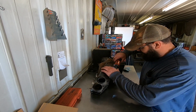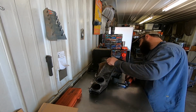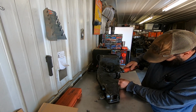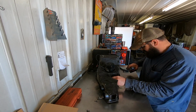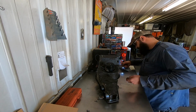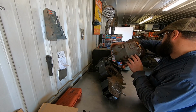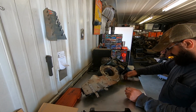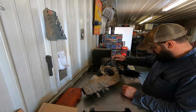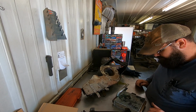So we're gonna blow this heater core housing apart. 5/16 socket. Sometimes these even come with a prize inside. Oh yeah. It's a little greasy in there. And then you pop this fancy little Ford patented clip out of the way. And Yahtzee, you've got yourself a nice greenish coppered colored heater core.